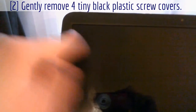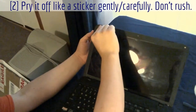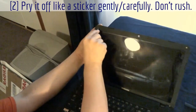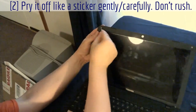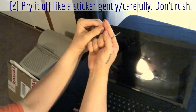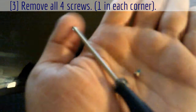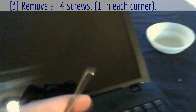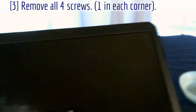There's one up there — these little black screw covers. There are four screws, one in each corner of the screen, little miniature screws. I use a miniature pointed Phillips to get them out. Take all four of those out.